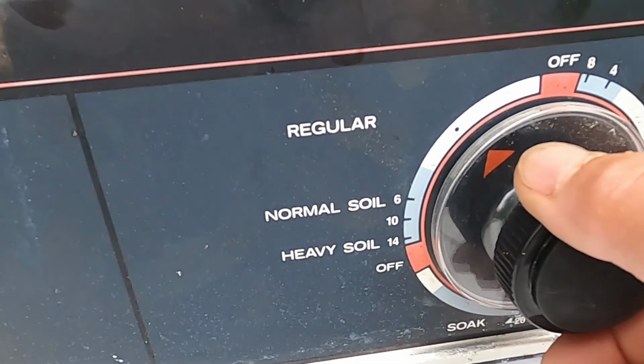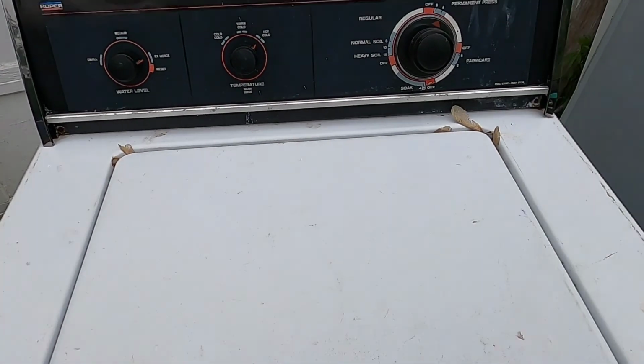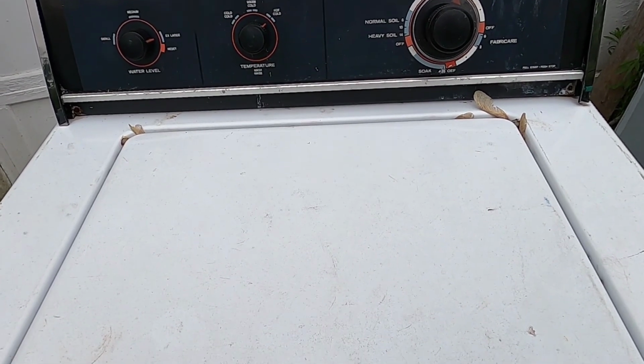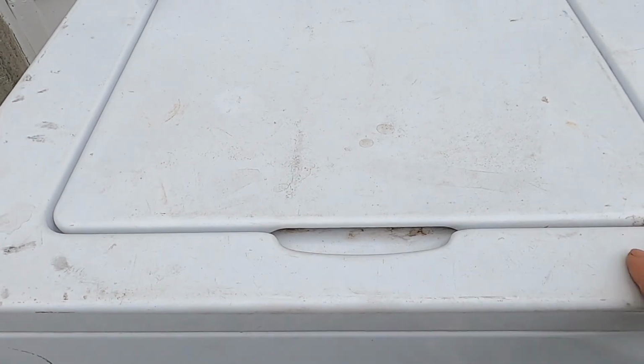To fill the water, you hear it working. The switch is working, and the motor is also humming. Now, the humming on that motor could be from a bad capacitor, or it might be as simple as something blocking the motor. So before I dismantle this and take the metal off for my other project, you can always pick these up, they're always around.